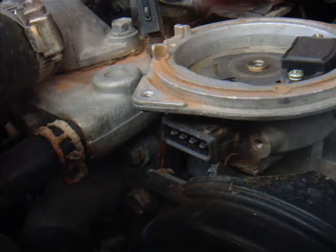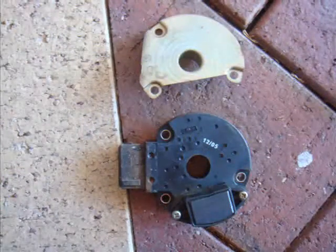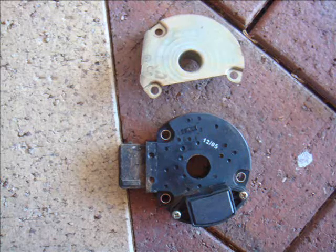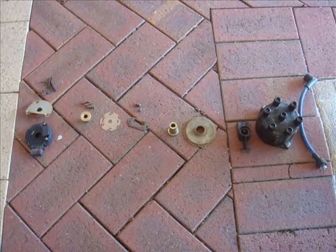You remember that you removed the crank angle sensor cable. There is a little metal cover plate around where that plugs in. There are two screws holding that in place and in theory there should be a dust seal right behind that. If your truck is anything like mine, that dust seal is well and truly gone. Once that's gone you'll look down and see that there is a metal cover sitting over the top of your crank angle sensor. That's held in place by three screws. Undo those three screws, remove the centre locator, and then you'll be able to remove the crank angle sensor and the metal cover — they won't come out individually, you have to bring them out at the same time. It might take a little bit of wiggling but it will come out pretty quickly.